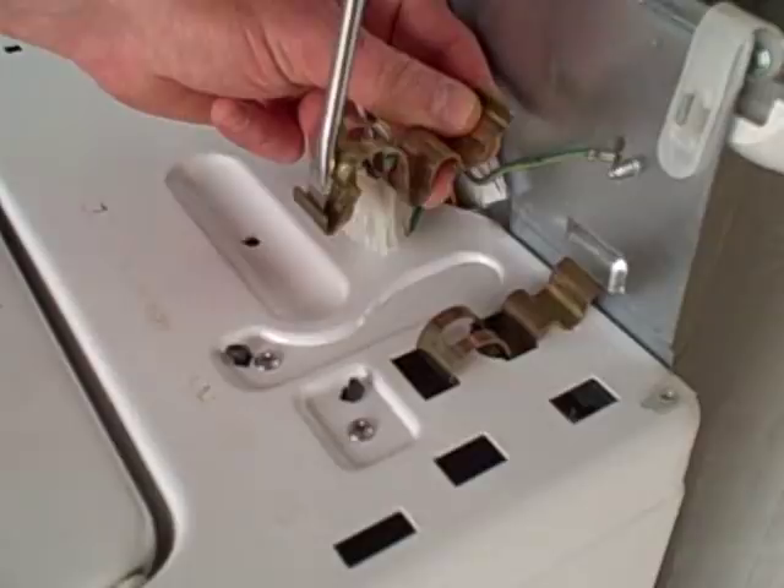The body of the machine is held on by two clips. In order to remove these clips, we take a flat head screwdriver, stick it into the lip of the clip and pry back. To remove the body from the machine, lift the lid, grab the front with your hand, rock back towards you, brace it with your knee and lift out of the way.